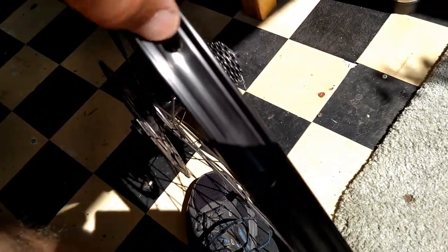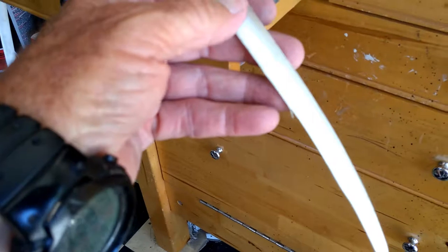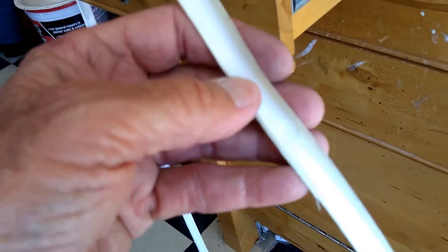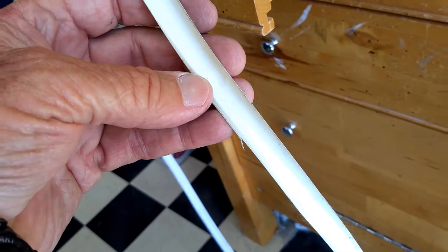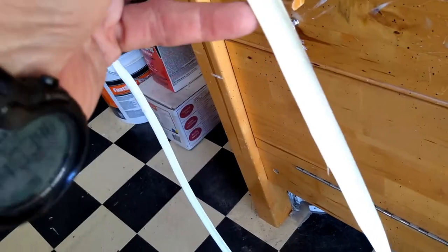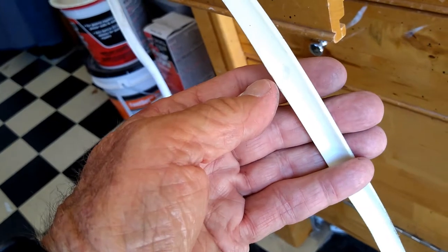That's probably not really unusual — I doubt that most bike factories polish these things. Those little burrs typically are not a problem because, as we all know, there's tape. The tape goes over that and it's supposed to cover up those holes. If you look at this right here, you can see where the hole is covered up for the spoke. But this tape was not centered, and that causes a problem.